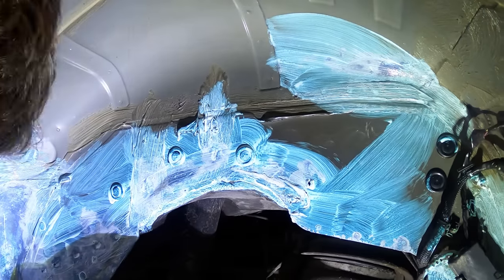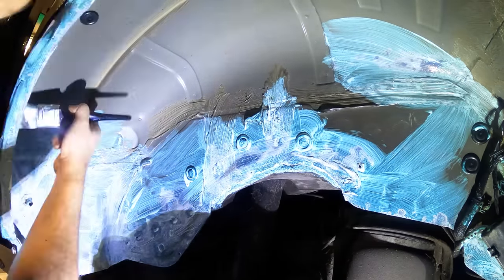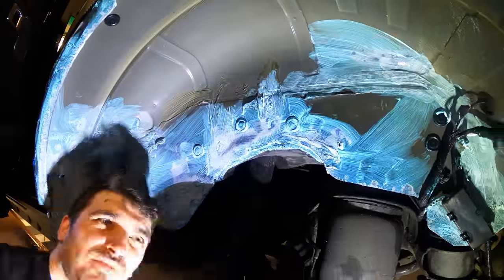I didn't coat the entire surface, as there's really not much point in putting this stuff on top of already good paint. From what I understand, it actually needs surface rust underneath it to react with and bond properly. So putting this on a good surface could actually hurt your overall protection, as we're going to be overcoating the whole arch later with LANOGUARD spray.